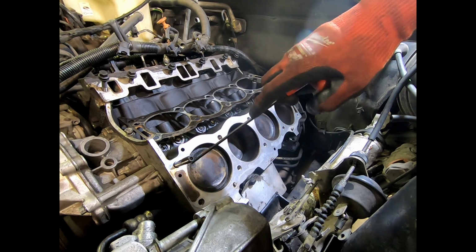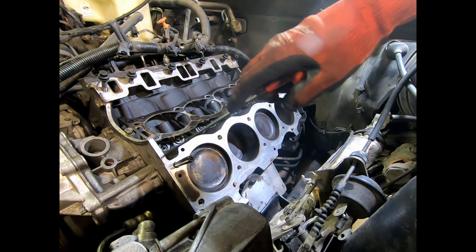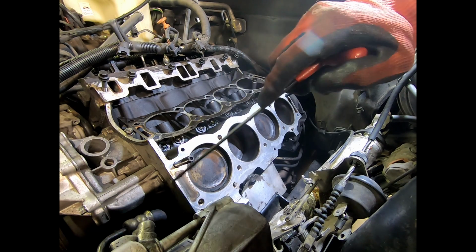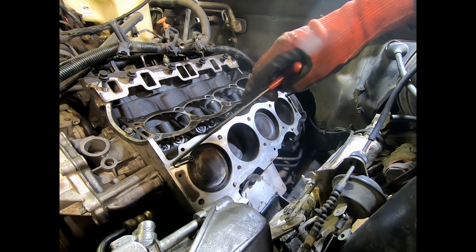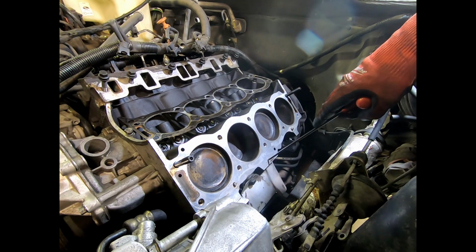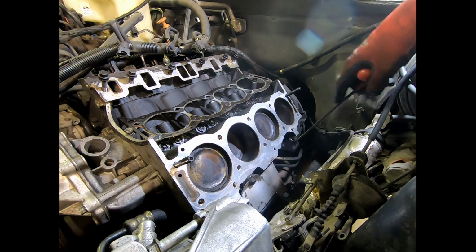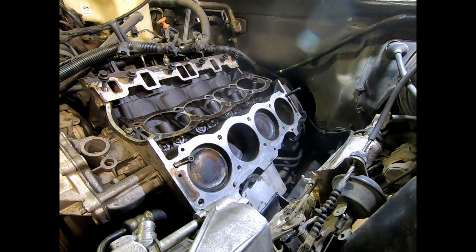I've cleaned this whole surface, including these two, because you actually do have the head and the head gasket sitting on these two sort of shoulders that come out. So clean this whole surface here. Everything's shiny, basically. It'll come right down to around here. Same thing, and it'll actually come right above there. So that is visible. And here. So, got these two on. Next is the head gasket. In fact, we can just take a little field trip.